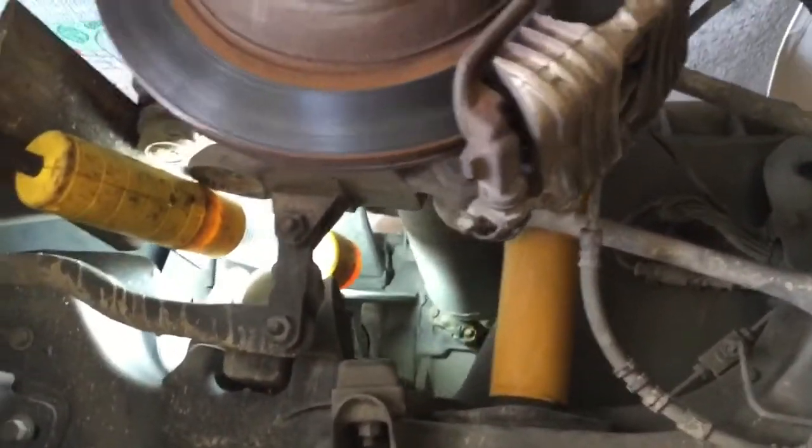I've been cleaning parts for about 30 to 45 minutes. You need to clean things up so you can properly inspect them. Looking at the yoke I could see where it had been nicked and dented by whoever did the previous replacement, so I took a chainsaw file and dressed that out, then used some abrasive cloth to clean the inside. I've got the snap rings installed in one side of the yoke only — that's how I'll reassemble it. The bolts and straps are cleaned up and ready. I wish I had bought new straps. Also, use good quality u-joints — these are Moog brand.